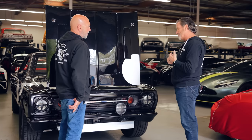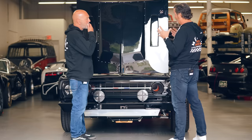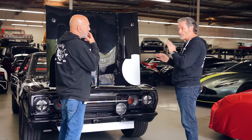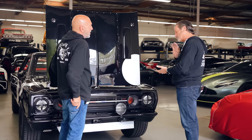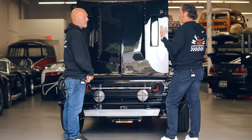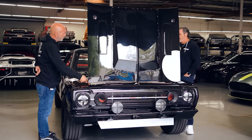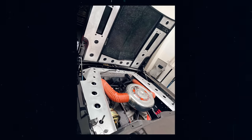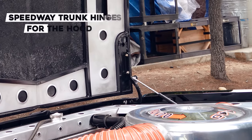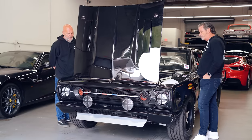The hinges are actually a bought part — from Speedway. They make great vintage pieces, and these are vintage trunk hinges but all adjustable, so you can pull the hood forward and back. Did you dyno it? 625 horsepower with 575 lb-ft of torque. It's mated to an SST TKO five-speed with a hydraulic clutch and a Centerforce clutch assembly. The car is geared to do about 185 mph — whether you choose to do that is another question.